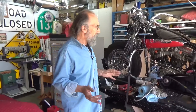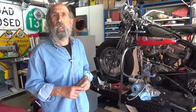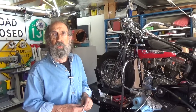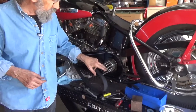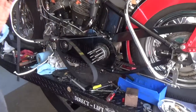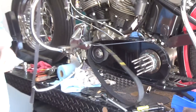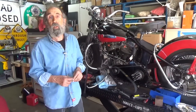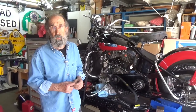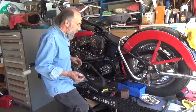So I took it all apart, cleaned it, and I want to go back through the changes I made - maybe there's something here to be learned. I did put a new seal in the clutch hub nut - actually I put double seals, because it is a deep enough machined surface that you can fit two seals in there. A lot of guys do that. It just makes it feel a little better. The other thing I did was yell and scream at Fred to please never overfill the transmission again.